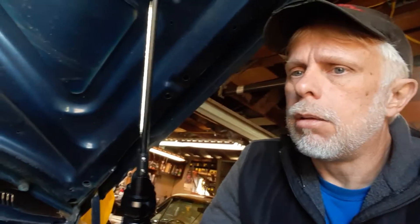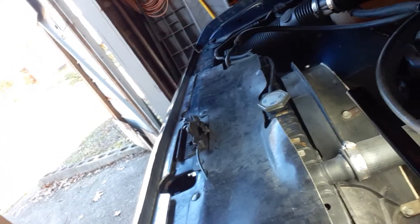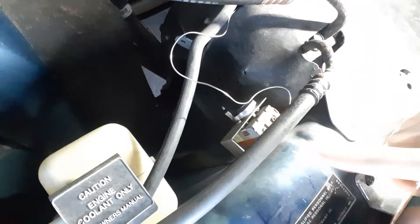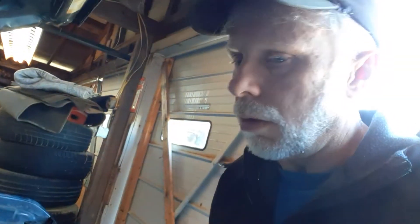This is a three-row core radiator, I believe. That's another change I made — I know the original radiator was a plastic and aluminum piece. This one is not. This is an all brass and copper radiator that I replaced the original one with, and it works exceptionally well. To control the fan — turn it on and off automatically — I have this controller right here. This is an automatic controller that is settable; I can turn it to certain settings. It was really, really dirt cheap but has been very functional and worked really well, even though it's been really dirt cheap — and I bought it years and years ago.